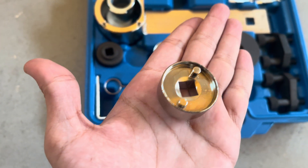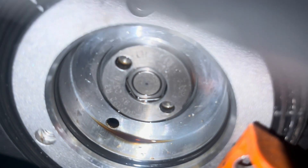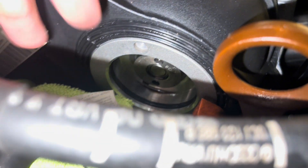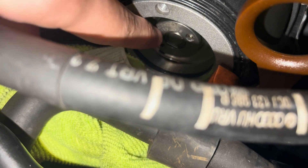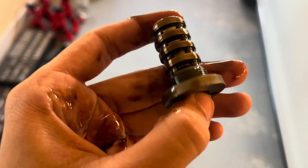To remove the old N205 valve and replace it with the new one, you need a Volkswagen-specific tool — I'll have the link in the description. It's actually a righty-loosey, lefty-tighty, so opposite of what you'd normally expect. The tool has three little extension pieces that pop in. It was coming out turning right, and here it is after removal — a little bit of a struggle but it shouldn't be too hard.